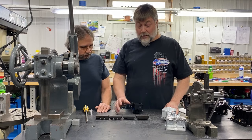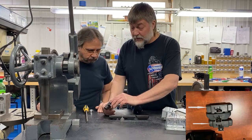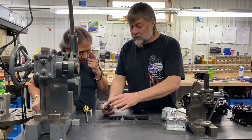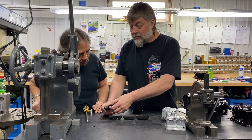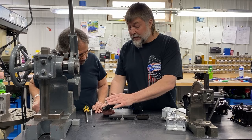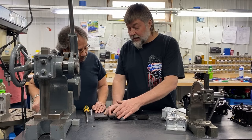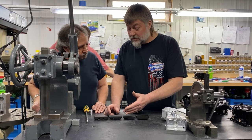And the adjustments, the biggest thing that's different there is the parting line of this float. The reason that we use that is it's a reference point. They tend to move around a little bit, but that is where the top and the bottom of the mold meet. So it's very consistent from a given style float to the next float. Now, different style floats will have that parting line in a different spot. So that's the difference for different adjustments as far as height.